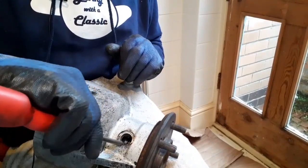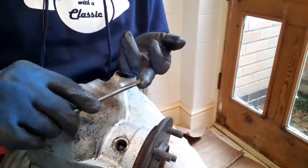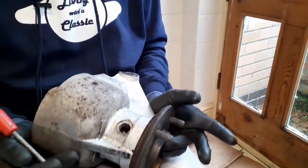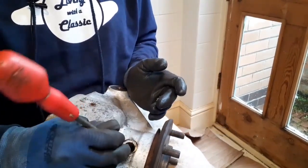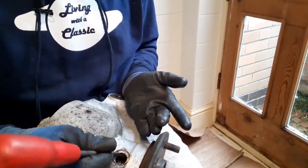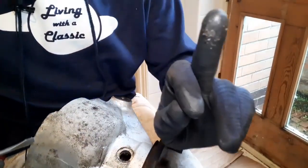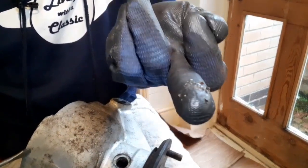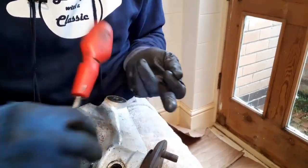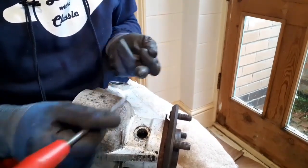Of course I'll put copper ease on. I've got to be careful because there's fragments of metal here. I do not want those fragments of metal falling inside because I'm going to be immersing this in solvent again in a few minutes - fresh solvent. The last solvent I used ended up completely black. There are little tiny metal shards, and I'm just trying to fish them out with tissue and rags before I immerse. I don't want the solvent washing metallic particles inside the bearing, for obvious reasons.